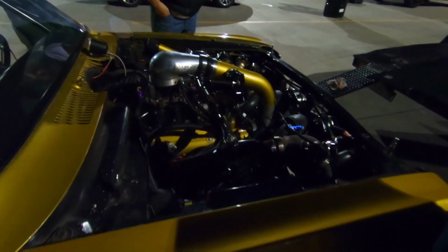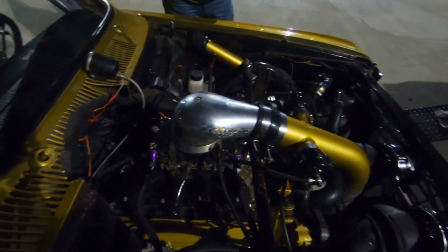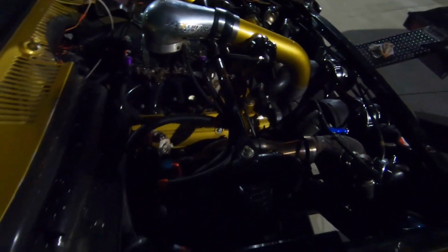But I don't think the motor's hurt. No rods are out the bottom, all that kind of stuff. So now it's either head gasket or it's just that plug hole. It's something, but either way, the head's got to come off. So it's another video. We'll let you see our process of that. But otherwise, it's just a big filthy mess everywhere and water blown out and all that kind of stuff.